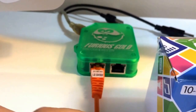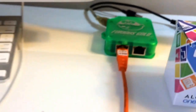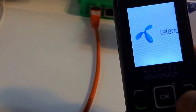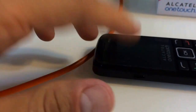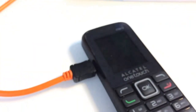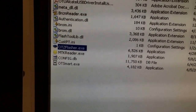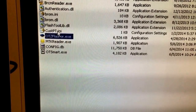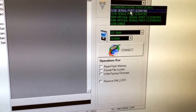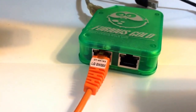To connect it, we are going to use the Furious Gold interface and an LG GW300 serial cable, as this phone is not connecting over USB. So I'm going to power off this phone and now I'm going to connect the cable. Software started. From the ports list I'm going to use USB serial port 194, which corresponds to the port on which we connected the cable.